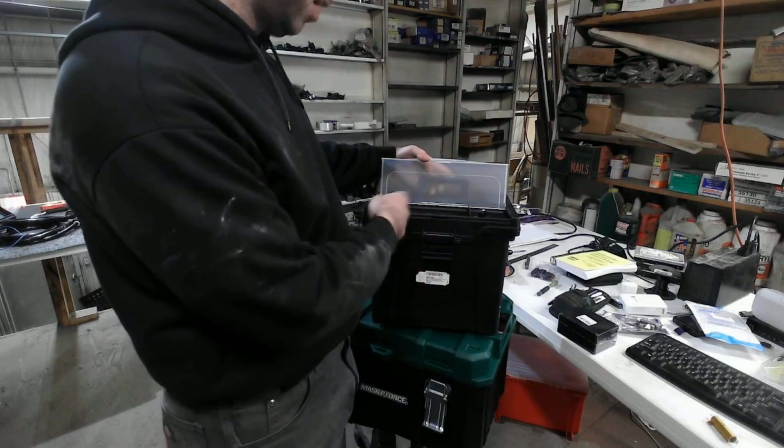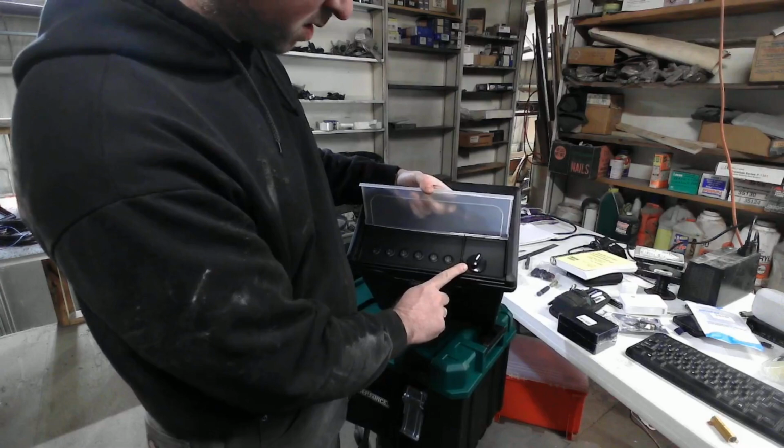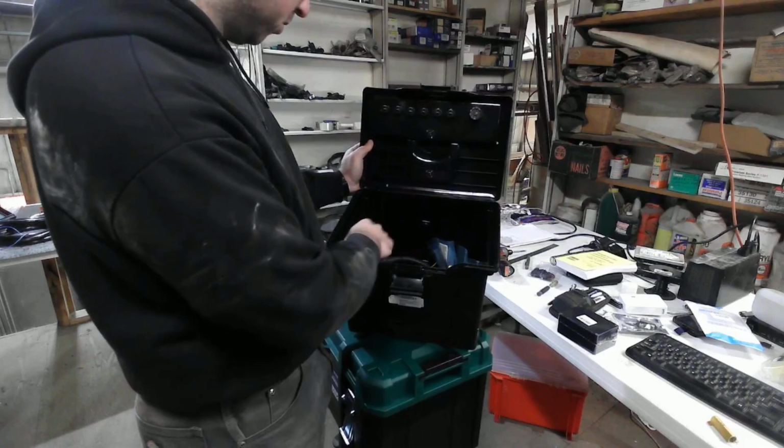So this seemed like it was going to be really good. Got all the switches in, room for LEDs. This switch here is a single pole 7 throw switch, so it's perfect for power in, off position, and then 6 outputs. Got some zip tie holders here.